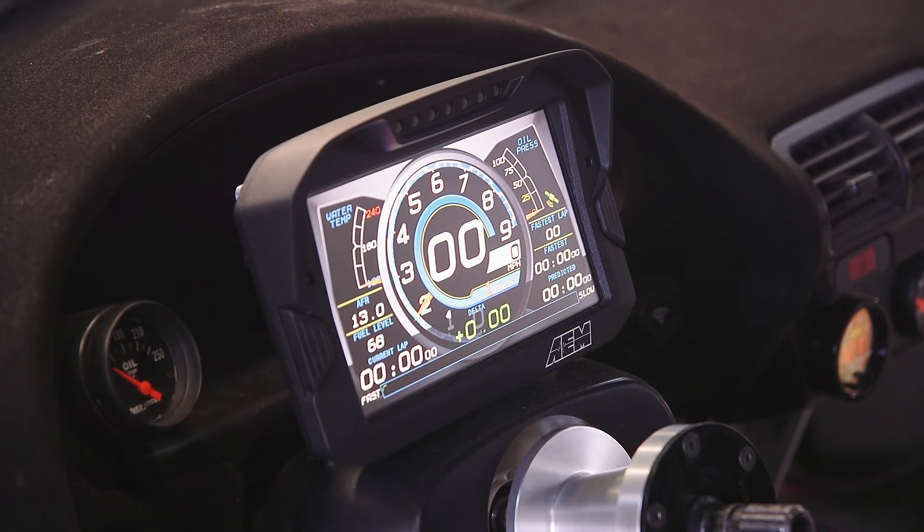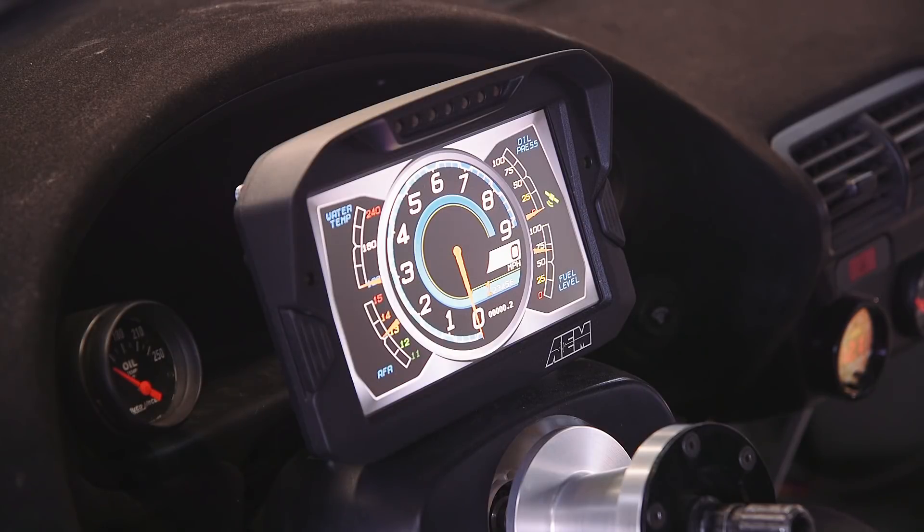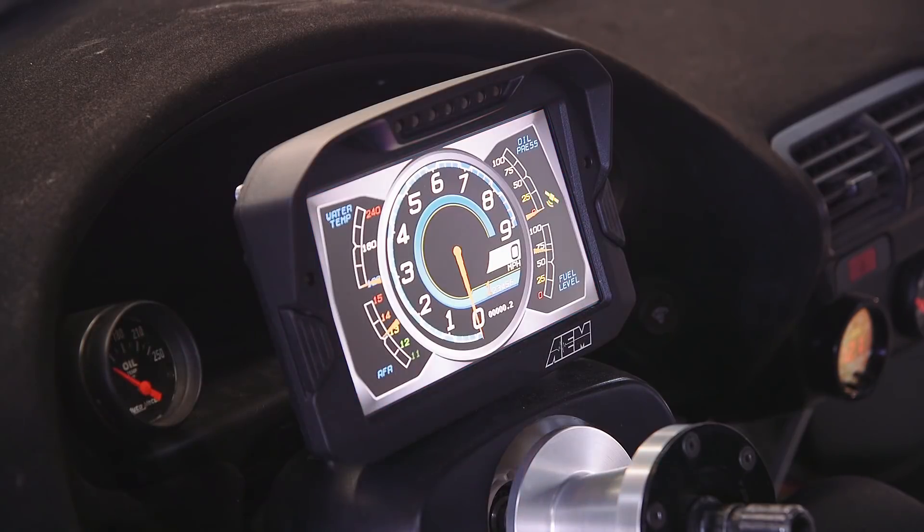You'll see that we get that same warning on each page. On the third page, the warning bar is at the top, and on the fourth page, the diagnostic page, it's down at the bottom — we get red text. Beyond the warning, we have our alarm. If throttle goes above 85%, so if I put my foot to the floor, you can see now we've triggered the alarm page. With the alarm page triggered, I can actually come off the throttle again, but the alarm page latches. At this point, the driver has to make a decision: do I stop the vehicle, do I shut the engine off, or can I choose to ignore this and clear the alarm and continue going?